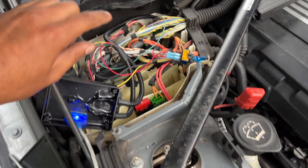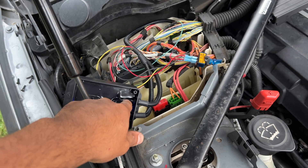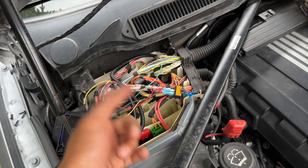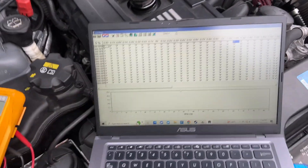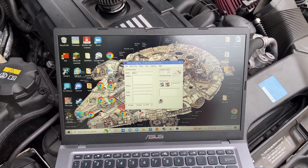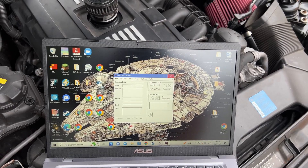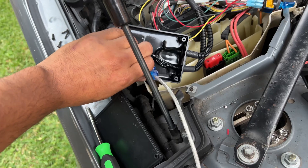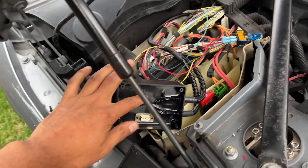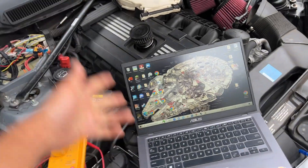For me I still need to go to the gas station and pump E60 into this thing. Once it's done flashing I'm going to turn it off right here with the toggle switch so there's no more power going to this AIC. Then once I get to the gas station, pump the E60 in, flash the tune on AMHD, I can come over here and flip the switch to have the port injection activated as well — and we're done. Close it out, disconnect from ECU, File > Close Customer, disconnect everything, and you're basically done. You've flashed your port injection controller. Put the screws back on, cover it up, make sure nothing gets in there. That's how we wired it up and set it up — hope you guys liked the video and hope it helped. Thanks for watching.